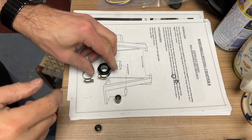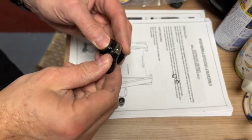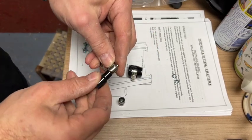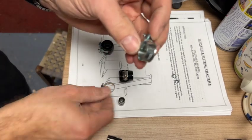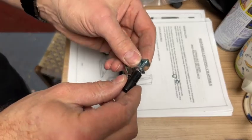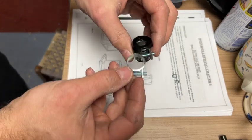Before we start the wiring, a quick top tip on fuel lines. Sometimes jubilee clips fail or you just can't get them tight enough. They're not always shaped well to get a screwdriver in, especially in restricted spaces. So I've been switching these jubilee clips out for something more substantial — basically a nut-and-bolt type clip instead. These are a lot better; they always fit a ratchet, so I can get them really tight around the fuel lines because that's somewhere I certainly don't want leaks.